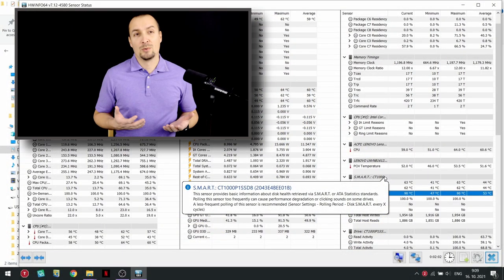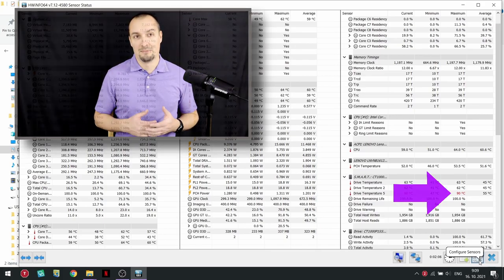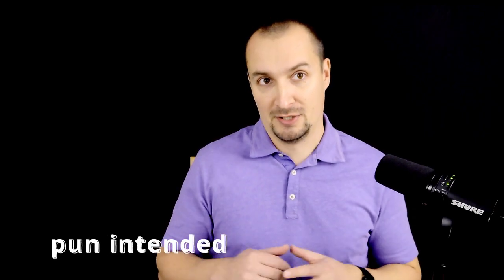I use Crucial P1 in a laptop, which is likely the worst case scenario in terms of thermals. You can clearly see the drive struggles big time. Unfortunately, there's not much one can do to improve SSD temps inside a laptop. There is simply not enough space to install an aftermarket heatsink. If you therefore plan to add a new NVMe SSD into your laptop, do your homework and read the reviews to ensure you do not burn your fingers.